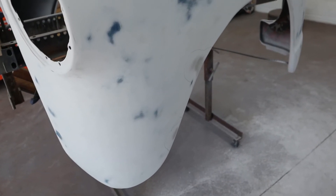So I'm going to take some 80 grit and just rough this area up. That'll get rid of the dry guide coat and it'll give us something to stick the glaze to. I stay inside my lines and that's all I do. I'm going to go around and do that to all these little spots. Got a couple of little ones here, a little one there, kind of a crease thing going on here. I can't believe I didn't see that when I was blocking out the first time. On this other fender it's a lot less dramatic — just a couple of little spots.